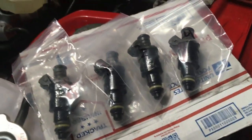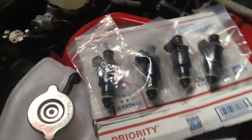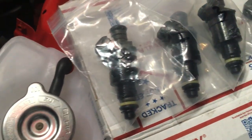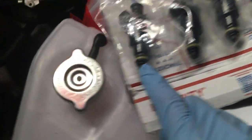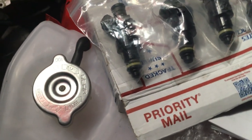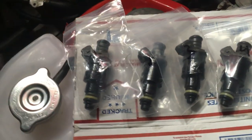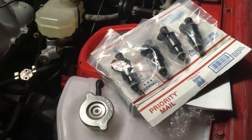Here's a quick look at the injectors, and as you can see, they look really nice. I had these sent off to be cleaned and flow matched. They also repainted them and replaced the O-rings. Anytime you remove the fuel rail, I recommend replacing these old rubber O-rings, since when you go to reinstall it, they can cut and tear very easily. If this O-ring here tears, then you'll end up with a vacuum leak, which will cause a very hard start. And if this one up here gets cut at the rail, then you can end up with fuel spraying all over the place. However, new O-rings, once they're replaced, are less likely to tear and less likely to cause a fire.